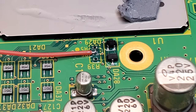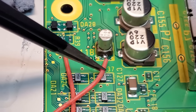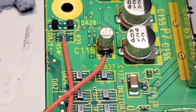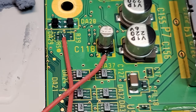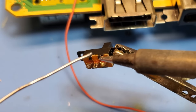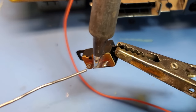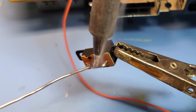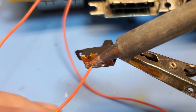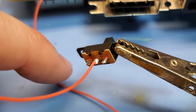More importantly, without doing this mod, US saves from my memory cards won't work. So this is an incredibly important step if you're importing consoles — switch the BIOS to US. This is an extremely easy mod; the only difficult part is installing that first wire because the solder points are really small. Use plenty of flux and make sure you get a good solid connection.